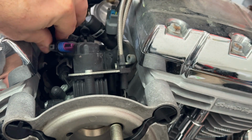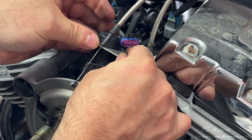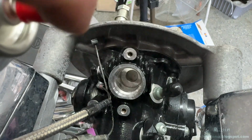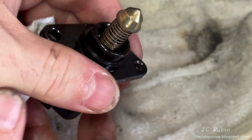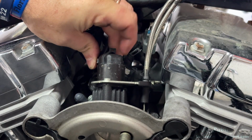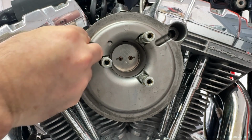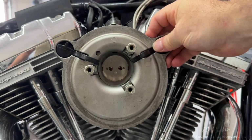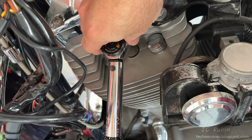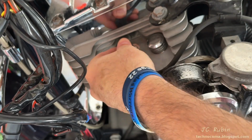The idle air valve was then removed for inspection, which required removing the throttle cables for access. Both the valve and throttle body were really nasty, requiring cleaning. Hoping this would solve the idle issue, everything was then reassembled, followed by the reinstallation of the throttle cables, the air filter mount, and all the pieces and parts. After this, the new spark plugs were gapped to 40 thousandths and installed into the engine. Surrounding aluminum cleaned up and cables reconnected.